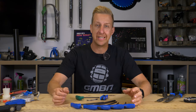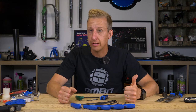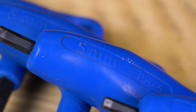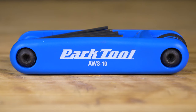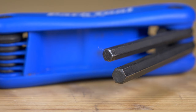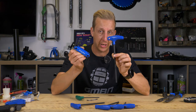Allen keys. I'm going to class Allen keys as a single tool because they are absolutely essential to work on a mountain bike — virtually everything on there is an Allen key of some kind. You can have a set of Allen keys, which is very beneficial for working on your bike. Workshop-spec Allen keys like this are expensive, but you don't necessarily need to go this far. If you want to save a bit of cash, a multi-tool such as something like this — the quality of the tools on here are absolutely fantastic. It's actually a tool I favor myself at home in combination with an eight-millimeter Allen key, which even if you had one on a multi-tool is never going to be that usable because you need the length in it. There are beneficial ways of saving cash and getting good Allen keys.